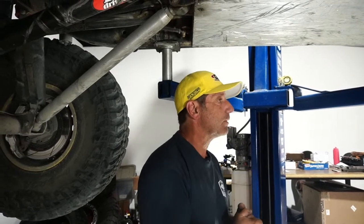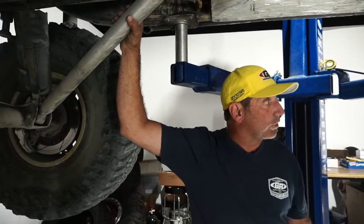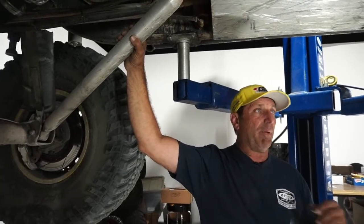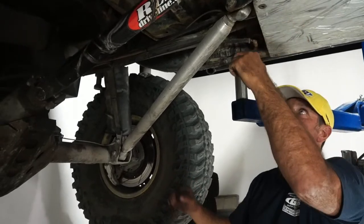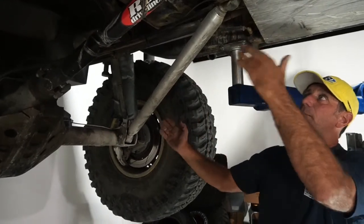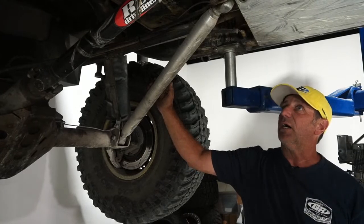Q&A: Downside to steel control arms? These solid aluminum arms are not exactly light. If you're paying somebody to build steel control arms, they're welding in the bungs, getting the length cut right, chasing threads to reinstall the joints. With aluminum, everything just threads in and you're done. It kind of depends on who you're paying — they almost end up being a wash if someone else is doing the fabrication.